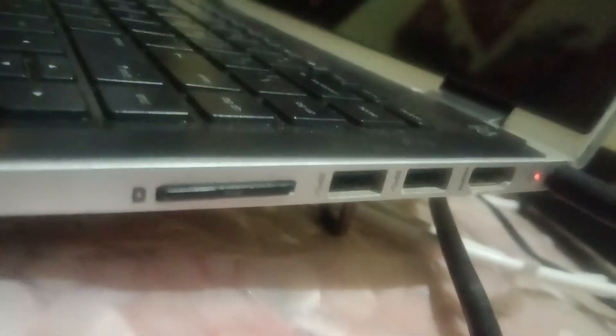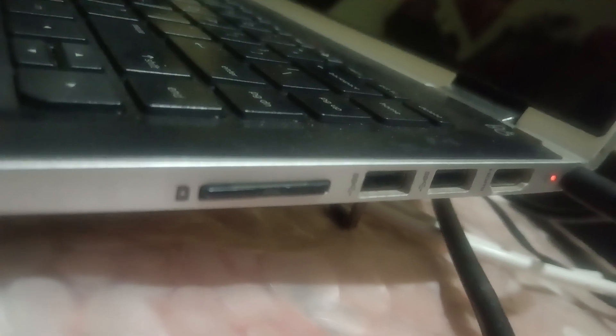If I plug in the charger, as you can see here, a red light is showing. If I remove and then plug it back in again, it shows the charging light — this means the charger is okay but the battery is not okay. Identify the issue like this.